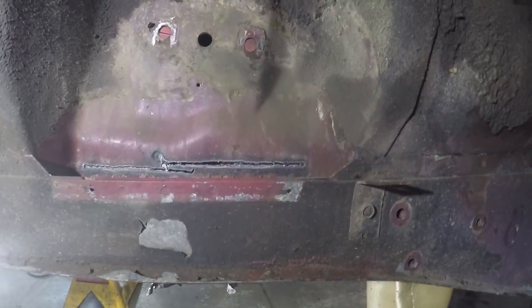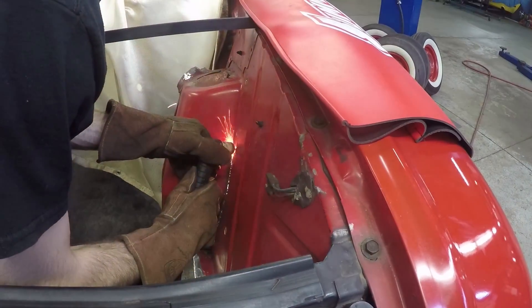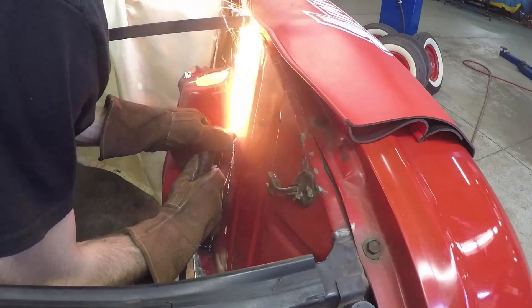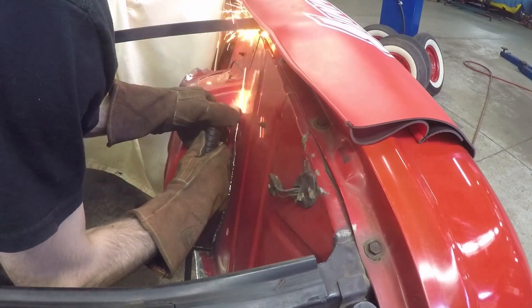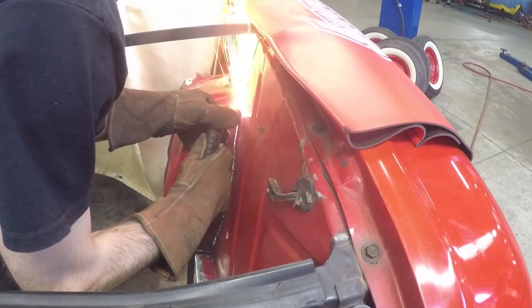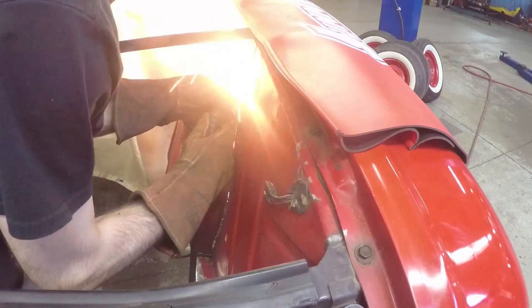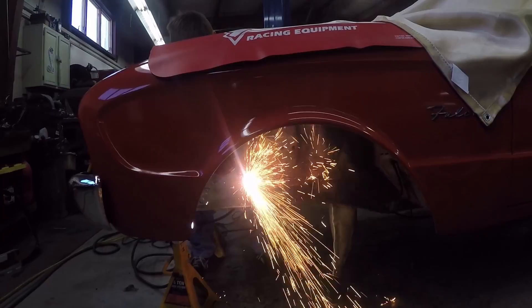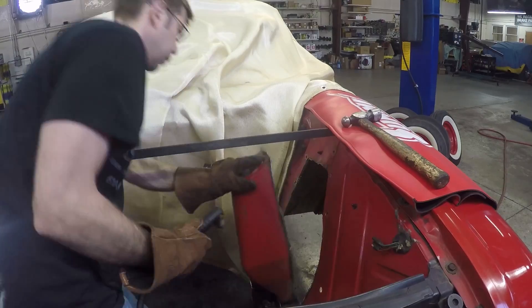Cut from the inside, cut from the outside — you'll probably be doing it both ways. It's best to cut right on the seam as you go around. Bruce is using the very technical 'don't look at it' technique. You can use the edge of the seam where the shock tower meets the inside of the engine bay wall — just cut right along there. It's best to cut too narrow than too wide because you can always cut out more. Can't go back.